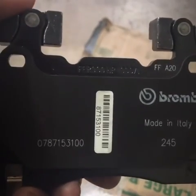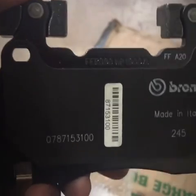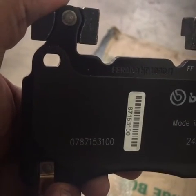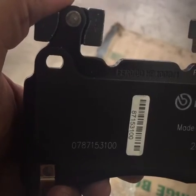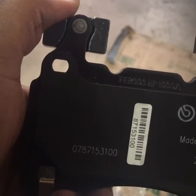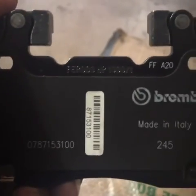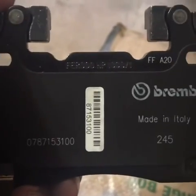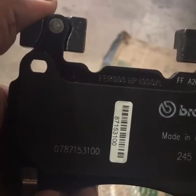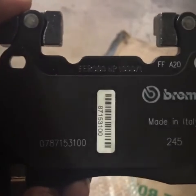This is what I'm going with. I took the caliper apart to do my brakes — to me that's easier, but it means I have to bleed the brakes afterwards. Make sure you have brake fluid with you and bleed your brakes after you put them all back on. If you don't want to do that, don't take the whole caliper bracket off as a unit — just take it apart by the two bolts and pop the pins out. But for me this way was easier. It's no big deal to bleed the brakes. I'm not going to put cheap brakes on Brembo brake calipers — I'm going with the original equipment.